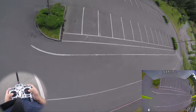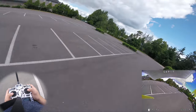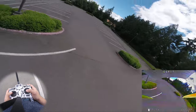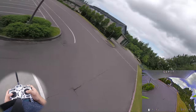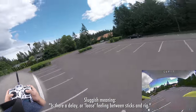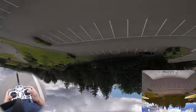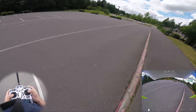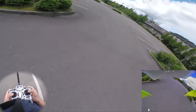So now that I is done, we can just really start playing with P — and that's a lot about feel. The stock tune comes okay, but the thing that's wrong with the stock tune regarding P-gain is that it's loose, right? Not enough authority. The best way to tune it is to just fly it and see if it feels good. If it feels a little sluggish, like it's not responding very well or very quickly and not quite doing what you want, then keep cranking that P-gain. Honestly, this feels pretty good. Pitch feels good. I can use a little more on roll — just feels a little tired.